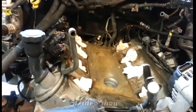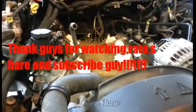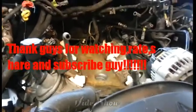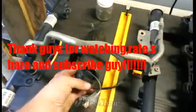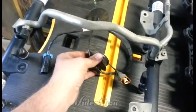But I'm going to fix that. Like I was saying before, I'm going to fix that problem with water getting around the knock sensors. I'm going to seal these to the intakes, the front and the back intake, off on the valley pan right there, guys. And on the grommets over here, I'm going to silicone around where the wiring harness goes down to the hole, and where these grommets slip down in the intake or the valley pan, I'm going to silicone around those, and then I'll fix it where it won't short out, guys.